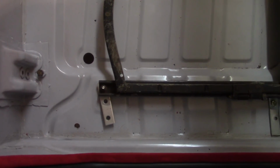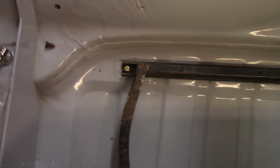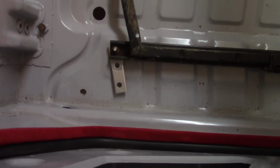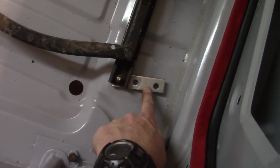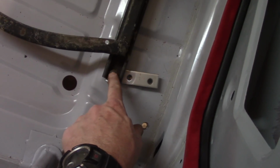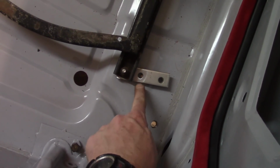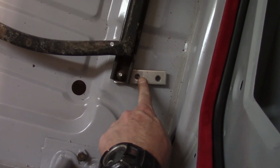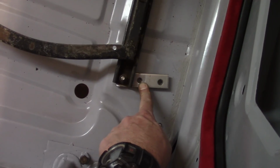So here's the idea with the seat rail. Again, the bolts on the inside, can't see that one because it's underneath, are fine. So my idea was to just essentially bolt a little flange, or not a flange, but a transition piece, I guess you could say, bolt to the existing hole on the seat rail, so that sits on the head of the bolt, and then just move this over with the thing and tap into the existing bolt hole and just screw it down.